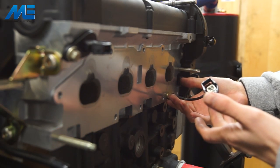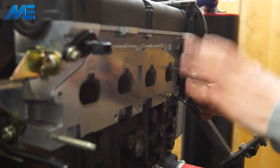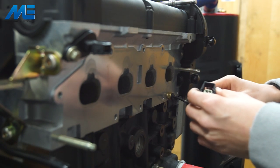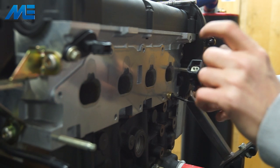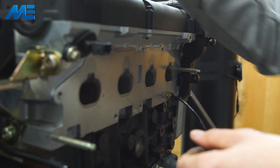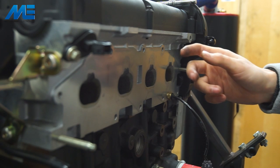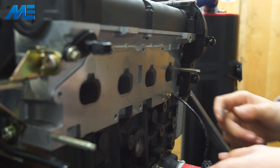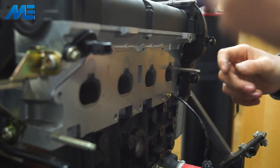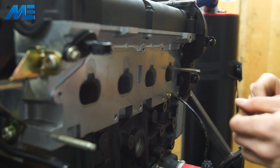This is the cylinder head temperature sensor that the Ford blacktop uses to measure its coolant temperature. The plug is different from the standard mini timer connection we provide on our looms, so we're going to retrofit it to fit our connections. We're going to cut that plug off and wire it onto our ME221 loom. Some Ford ZTECs do have a coolant temperature sensor in the thermostat housing, and if you're using a water rail setup you can fit a standard coolant sensor. Our loom is a two-pin mini timer connector — if you're using the circular Ford connection, take the plug from the donor engine and wire that into our loom.